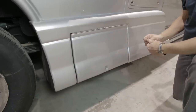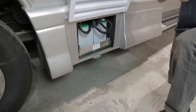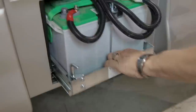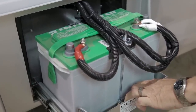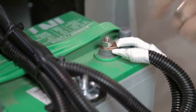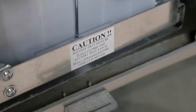On the passenger side is the battery compartment, unlocked with the 751 key. Lift the door to access the SRM 27 series battery. Lift and release the locking pin, then pull and slide the battery tray out to check fluid levels and ensure battery post connections are tight and clean. White wires in this compartment are ground wires; all other colors are positive. Always ensure the battery tray is locked in position when traveling.